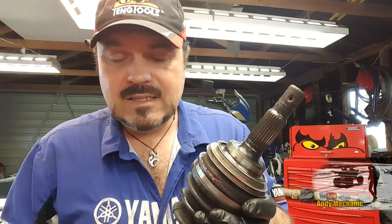So there you go — that is how to completely disassemble, inspect, and reassemble a CV joint, fitting the proper clips to hold the boot in place. It's a pretty important task. I know we don't do it normally in a garage anymore, but it's really useful for understanding how a CV joint works and for diagnostics. If there's a problem with a front-wheel drive drivetrain and it's click, click, click — can we fix it? No, it's going to go in the bin. But you do need some special tools and it's well worth buying these — it saves a lot of hassle. I've seen people trying to put those clips on using long nose pliers trying to roll them up; it never really works. These tools are very cheap — 20 or 30 bucks — and this one has lasted me 15 years. Money well spent. Make sure you've got a little tiny hammer too, because that's really useful for tapping those little tabs over.